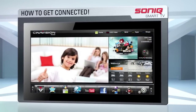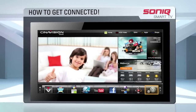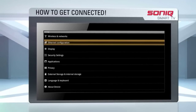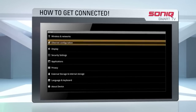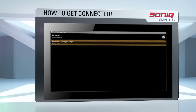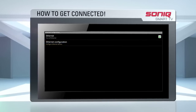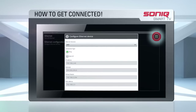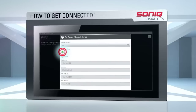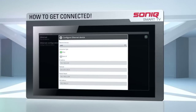If you're connecting via an Ethernet cable, move the cursor to the settings icon, which you'll find at the bottom right-hand corner of the screen, and press OK on the remote. Move the cursor to Ethernet configuration and press OK. In the top right-hand corner of this screen you'll see a box — if this box is not ticked, with the cursor over the box, press OK. If the box is ticked, move your cursor to Ethernet navigation. The default setting here should read DHCP; if not, highlight it by navigating with your cursor over the circle and press OK.